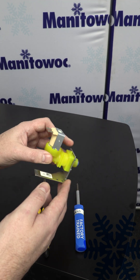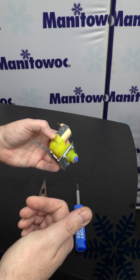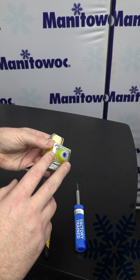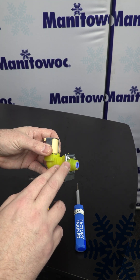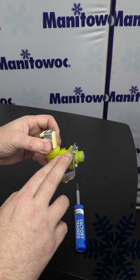In tech support, when we have checked and we have good voltage at the coil and we know we have good water pressure at the machine but we're still not getting that proper flow, this is kind of like a last resort. We like to check this water inlet valve strainer screen in order to make sure we don't have an obstruction at the valve.